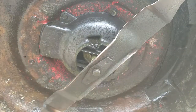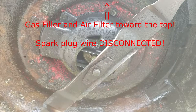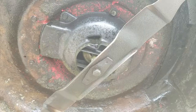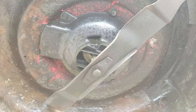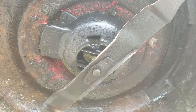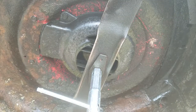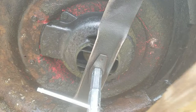Similar to my previous videos, this is not a sponsor video, so I buy the stuff as-is and give my honest opinion. The first thing I've done is tilt the lawnmower over with the oil side up and the air filter side up, so the fuel doesn't go. My fuel was very low so I don't have much risk, but just to be safe I put a plastic bag on top. Also make sure to disconnect the spark plug so while rotating it doesn't automatically turn on.